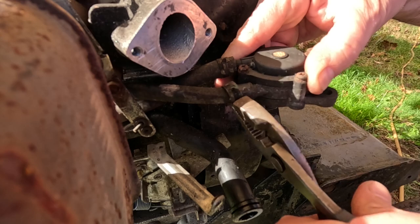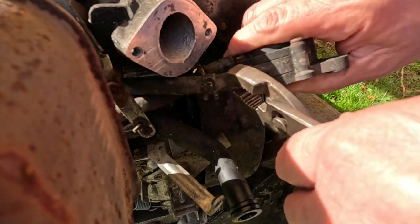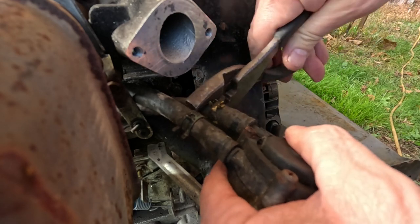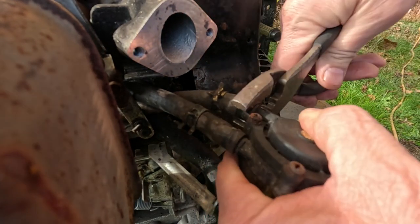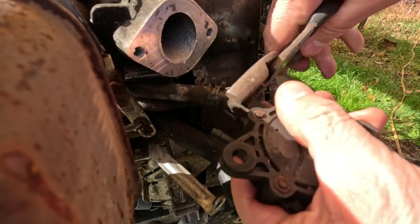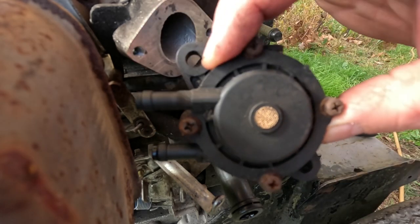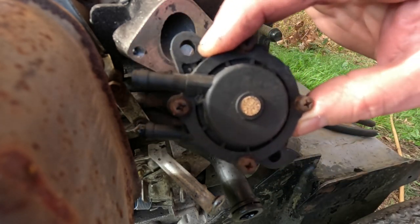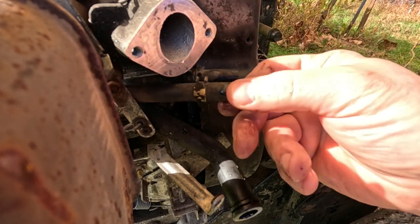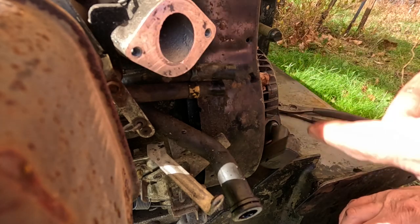This line comes from the fuel tank. We're going to pop these off — just give them a little squeeze and move them out of the way, then give it a little twist to loosen it up and slide them off. The fuel line coming from the tank appears to be okay, so we're going to leave that one alone. The one from the crankcase also looks okay. I am going to replace the piece of fuel line that goes to the carburetor though.